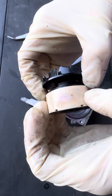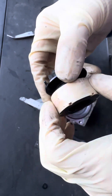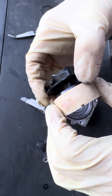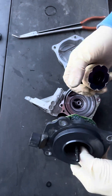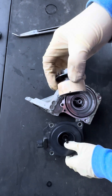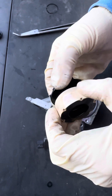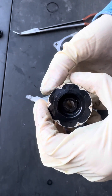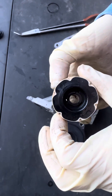It looks like the metal windings lifted up inside this plastic. Maybe it got too hot and expanded, and now it's rubbing the plastic housing and creating drag. When it got really hot — because after about an hour it would fail — the water pump was working hard, rubbing the whole time. The metal expands when it gets hot and eventually probably stops spinning because of this separation. It's out of round.